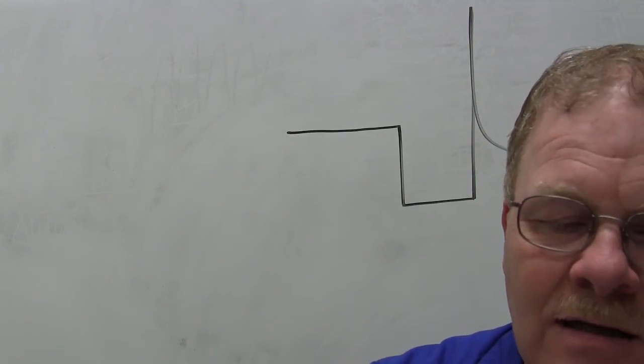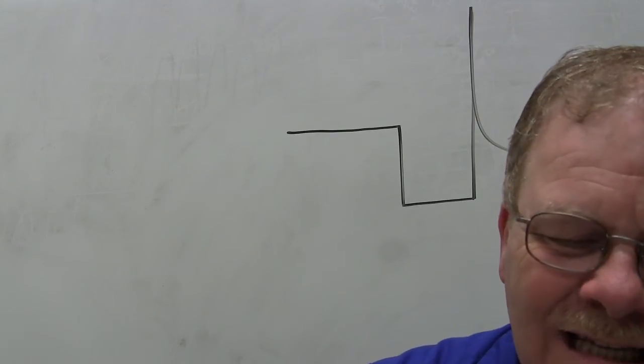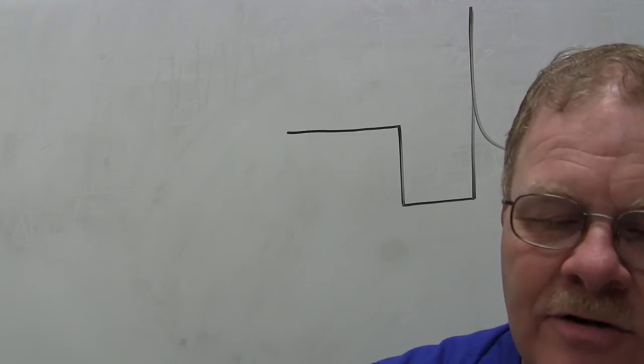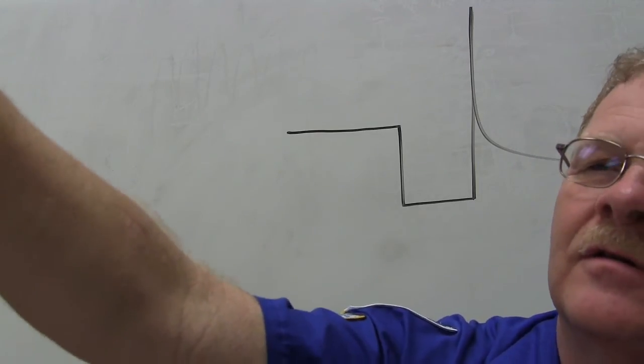Technician A says a power balance test is the best way to isolate the problem cylinder. Well, yeah, sort of. Technician B says a compression test and cylinder leakage test can help determine the cause of the problem. Who's done that recently? Compression test and cylinder leakage.